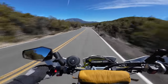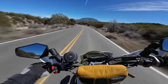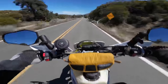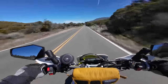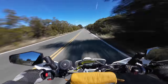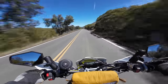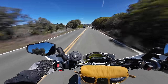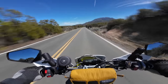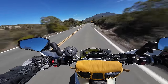I actually rode this bike, we rode almost 200 miles in Death Valley on one of our rides, and I didn't have much if any discomfort on the seat, so the seat is a huge win. In terms of riding on the highway, I feel like about 60 miles an hour, maybe 65, is about the max that I want to cruise at with the 1448 gears. So I'm going to try 1445 gearing and see how that does. We'll try that in one of the next videos.